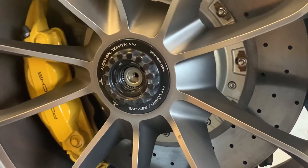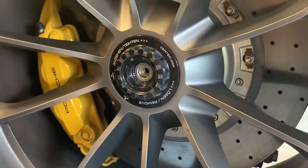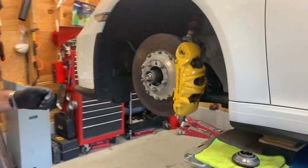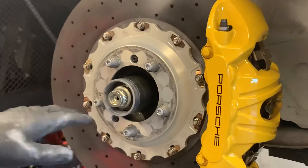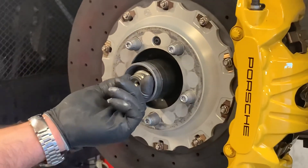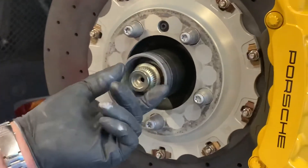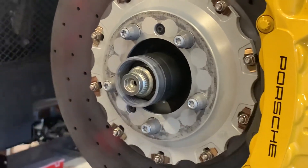Occasionally you may find it's difficult to get it to fully extend like that. In cases like that, it's typically because the lock pin assembly is gunked up or in some cases even rusted onto the hub. Typically this lock pin assembly should be able to rotate freely, and it's that rotation that allows the splines to drop back into the nut.